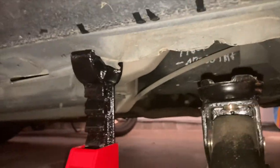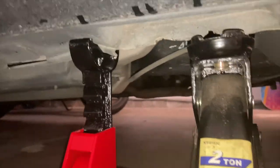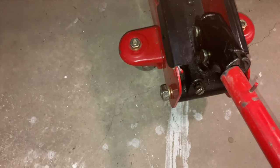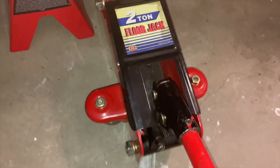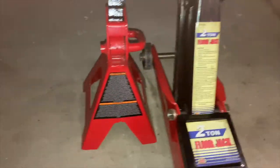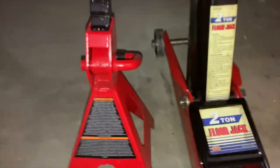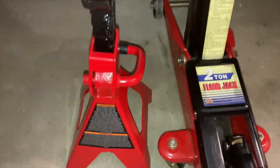What we've got to do is free this other jack stand. What we're aiming for is that steel rail right there. Once we get onto that hard point, we switch over to the lever, because the lever is a force multiplier and that allows us to crank it up. We've got to crank it up enough — there we go — to pull the jack stand out.